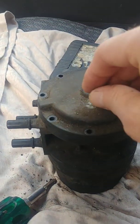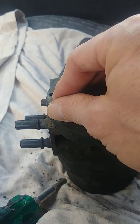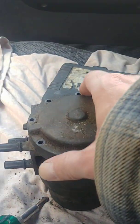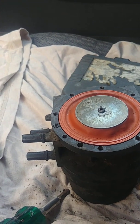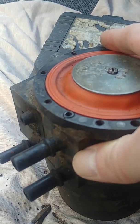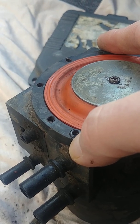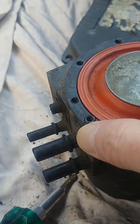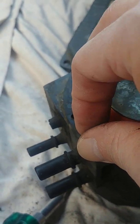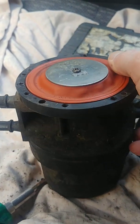This lid is held on this valve with these screws — they're quarter inch head screws. So once you remove them, you remove this cover, and there's an O-ring right there. See that O-ring? You can see a small indentation right there. There was fuel squirting out that indentation because either I or somebody that previously removed this cover dropped that O-ring.